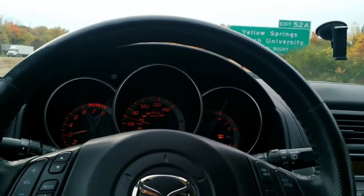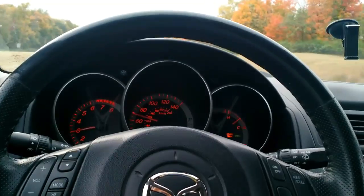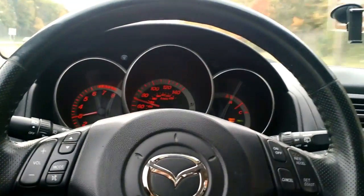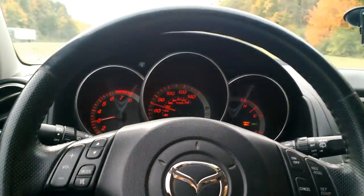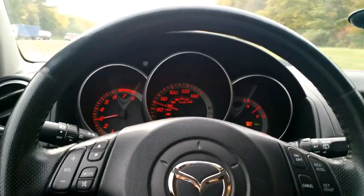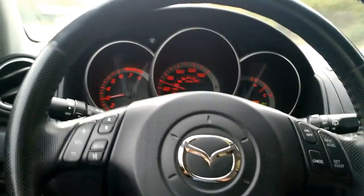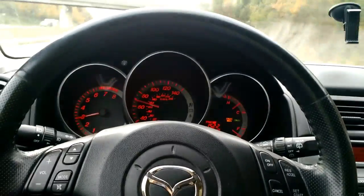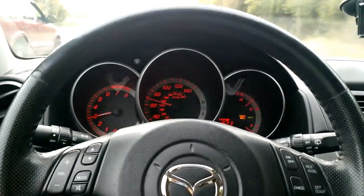The car doesn't really shake, but the steering wheel just goes nuts, and it'll stop for 10-12 seconds, then it'll start up again. And there definitely seem to be sweet spots where it doesn't do it at all. Now it's really kicking in for no apparent reason. I'm trying just to keep the car straight without reducing this movement. Drop it down a little bit.